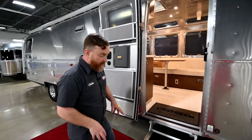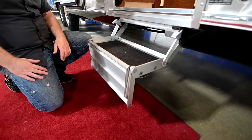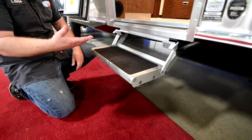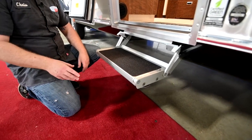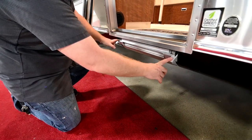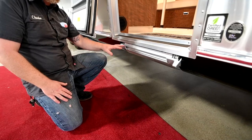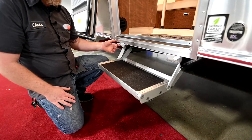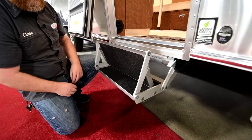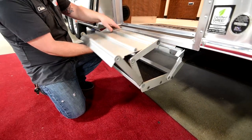To fold your step up, take your thumbs and push it on the hinges. Fold that lower step until it's straight up against the upper step. From here you're going to roll it onto that upper step, and in order to stow them both you will lift slightly to release the hinges and slam it up underneath. Please make sure your fingers are out of the way so you don't pinch them. You can grab one hook or another to bring them out — they are connected — but when you bring these up, hold them up so they don't catch the step as it passes. Make sure both sides are secure. To get the lower step out, lift the rear of the step and push the front edge towards the trailer, then roll it all the way around.